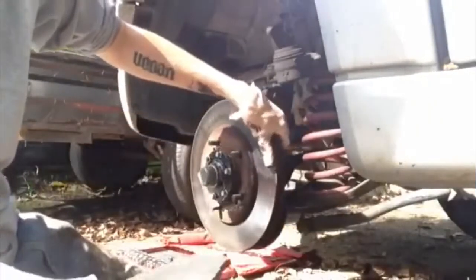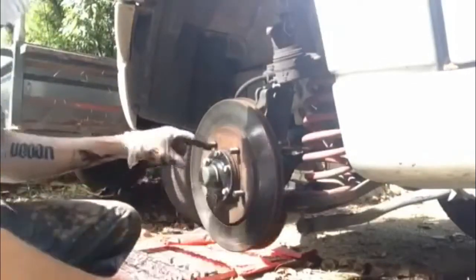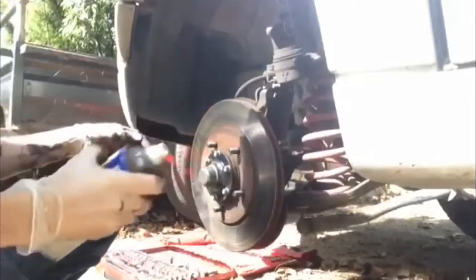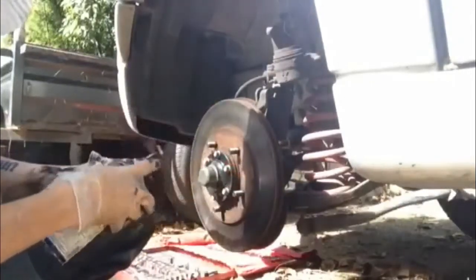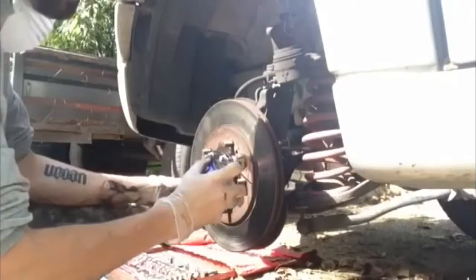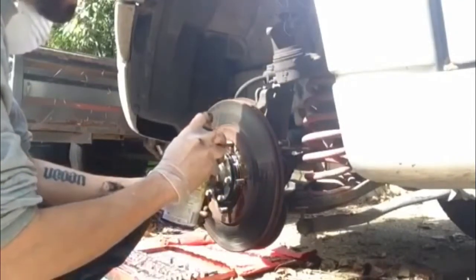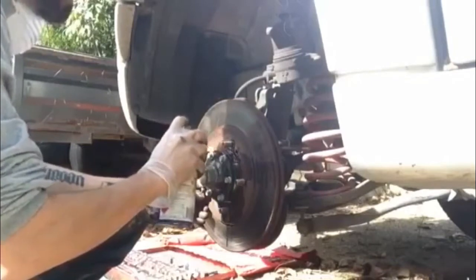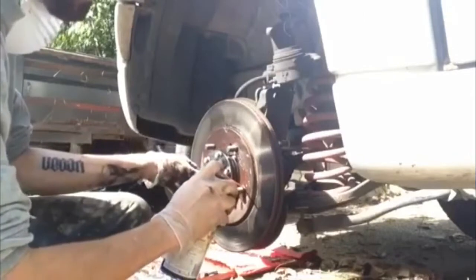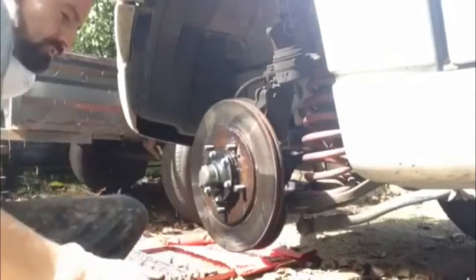When I get that off I'll show you the back of it because it feels shocking. The disc is supposed to pop off but it's really rusty, so I'm going to get some WD-40 just to soak it in. The back of the disc will be rusted onto the hub as well, so anywhere there's a hole just get some in there. It doesn't matter if it goes all over the disc because it's coming out anyway. I'm going to let that soak in for a little bit.